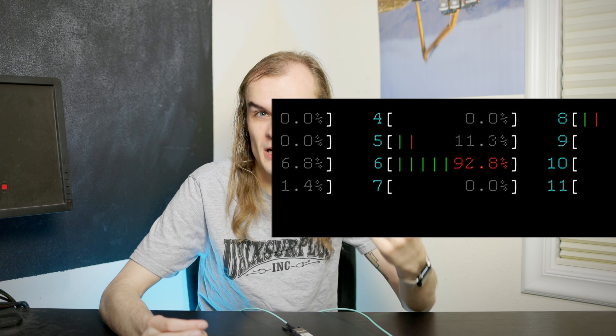So I went on a quest to actually reach the limit of 40 gigabit. I had a lot of hardware and software tweaks to play with, but the first thing I did was look at the system to find the limiting factor. One thing that often limits higher speed network connections is single-threaded CPU performance — network speeds like 40 gigabit have been increasing much faster than CPU single-threaded performance. On a Linux system, seeing about 100% CPU usage on a single core in HTOP indicates something is running in a single thread.